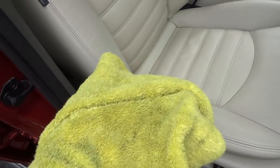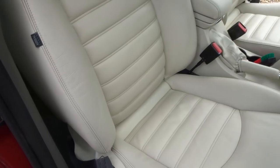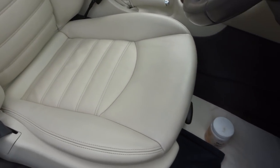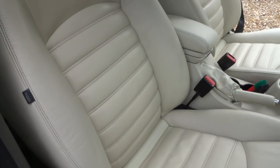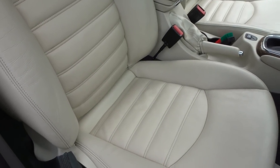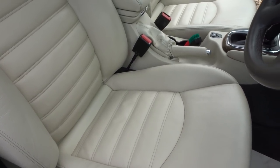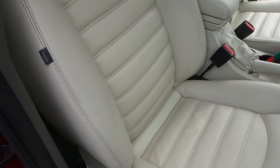So yeah, when you're scrubbing, microfibers and elbow grease. Don't be using chemicals and pushing the dirt into the pores of the leather. Proper leather skin does soak up and absorb things if the surface is slightly worn. And if you put chemicals on there, in England we use traffic film remover, we call it TFR, that's not what you want to be using. Yeah, it cleans it, but it will also turn your leather to cardboard.